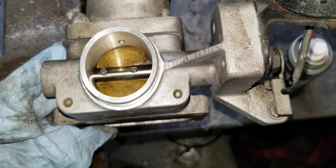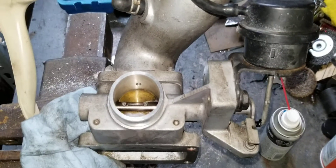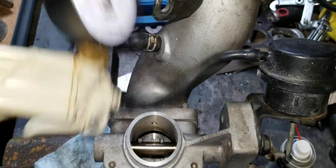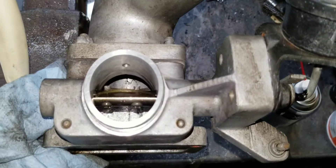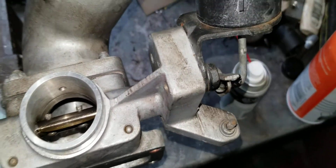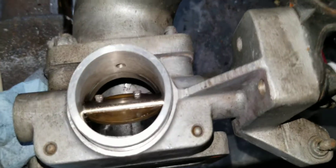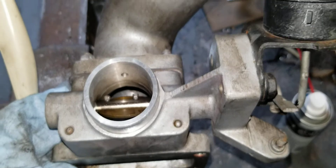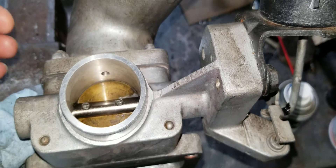You're building boost constantly because it's a belt-driven supercharger. To test your bypass valve and bypass actuator, you need a vacuum gauge. I'm just going to pump it up, open the valve all the way, and let it sit. Naturally it's going to want to close because it's under spring pressure, and there are slight leaks between the plastic and metal. But if it's holding and going back slowly, the valve is generally good because the engine is going to be constantly producing vacuum. It's a problem if you're squeezing and this valve doesn't move at all and doesn't hold itself.